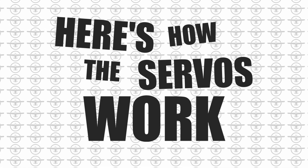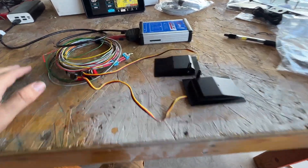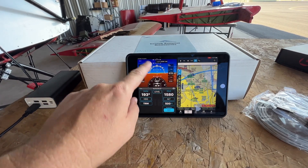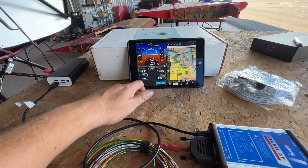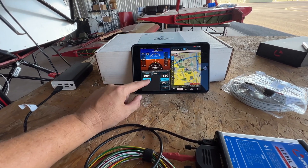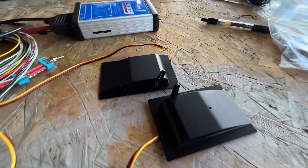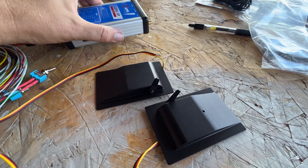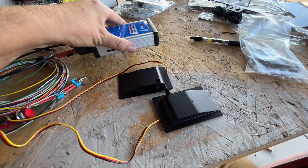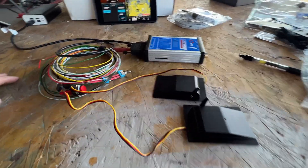I've got the unit running on USB power, hooked up to the harness which connects to the little servos. I've got a split-screen going with ForeFlight and the iLevel software — all the flight info on one side, autopilot on the other. It's in the off position right now. I hit 'Level' and everything changed — we can adjust heading, altitude, and VSI for feet per minute. When I pick up the unit, the servos move to correct for pitch, roll, and yaw. Really cool.